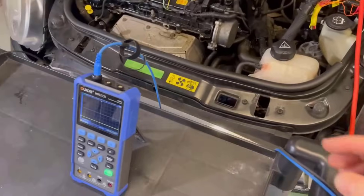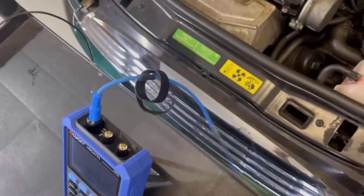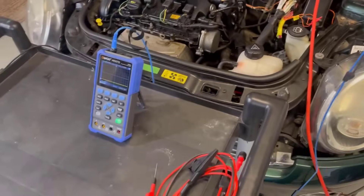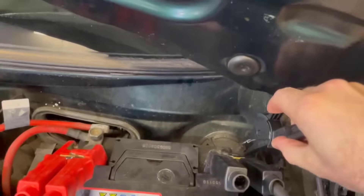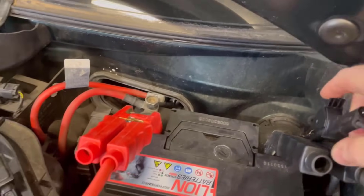What we'll finish with is a bit of CAN bus to see how it's going to handle that — that's always the question on everyone's mind. We'll take a look at a real crankshaft sensor signal and maybe have a look at some ignition as well. I'm quite happy that it picks up those square wave signals. I've just put the longer Picoscope leads on here because those short ones aren't very suitable. So we'll just put a ground on here.